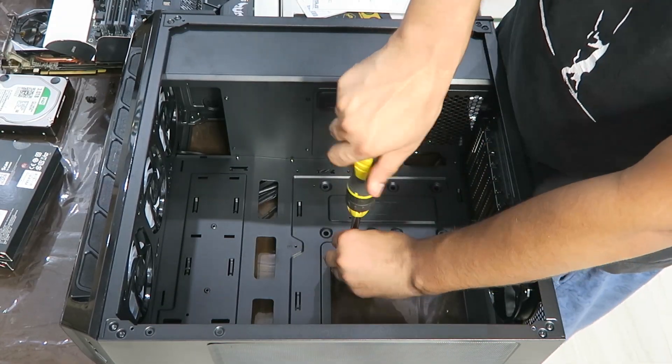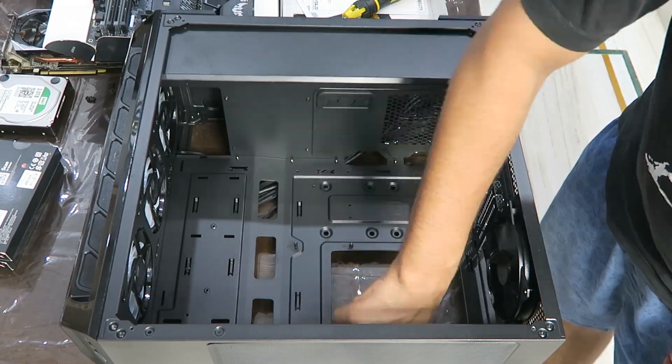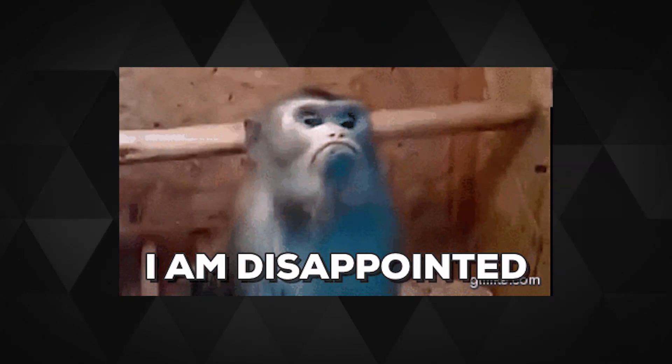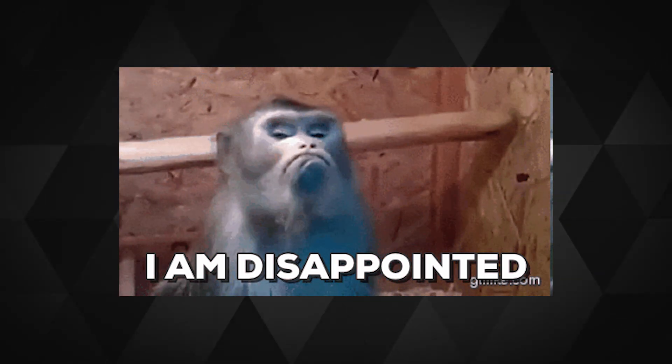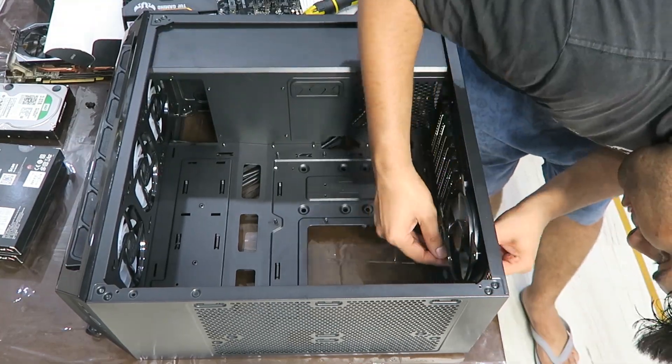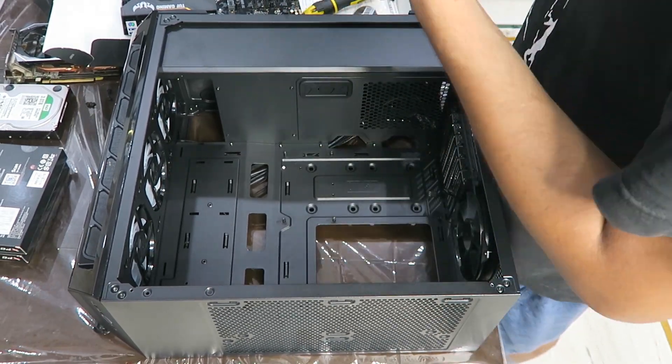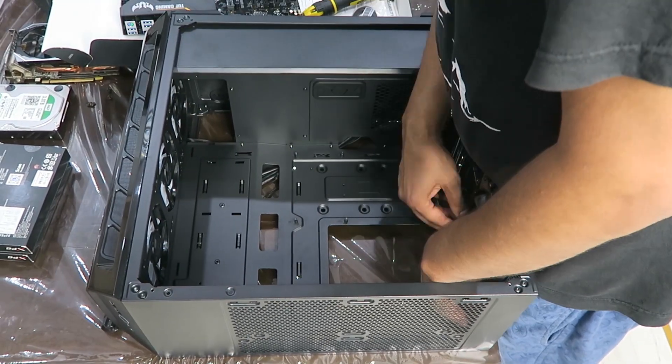I had made sure to count how many screws there were, but now I kind of don't remember. I also forgot to put the back panel I/O plate in — so that's two don'ts right at the beginning. Make sure you align the back panel to the layout of the motherboard correctly before clipping it in; you should be an expert at this if you've ever played with LEGOs.